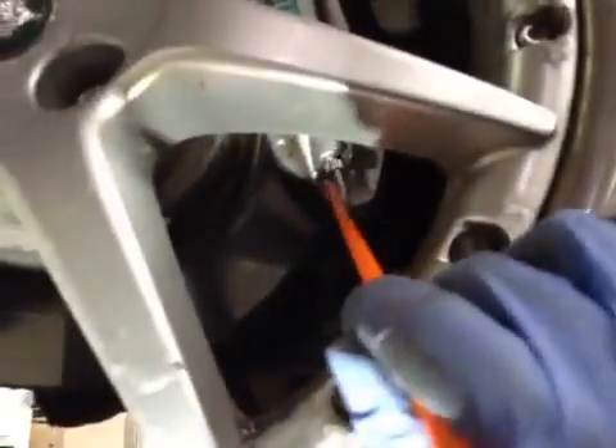All the same on the driver side — rear suspension is all looking good. The driver's rear tyre is in good condition. Again, the rear discs have corrosion on the back of the discs, and the rear brake pads are roughly on about 5mm. The pads are in amber, the discs are in amber, and the tyre is in green on the health check.